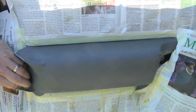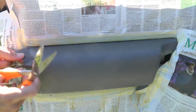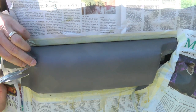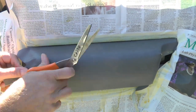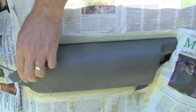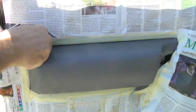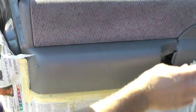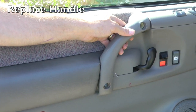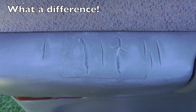The last part is this end, and being that this was one of my first attempts, it was kind of a challenge to get it right. Luckily it wraps around the top, so I took the vinyl and wrapped it around so that the seam would be down below and hidden by the door. Now I'm cutting it so that the two pieces match up for a nice fit. Take the masking tape and paper off, put the handle back on, and there you go — you have a nice repaired armrest.